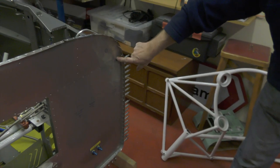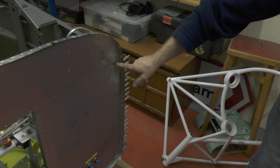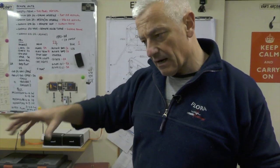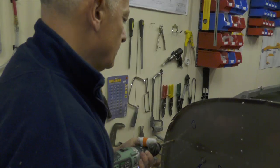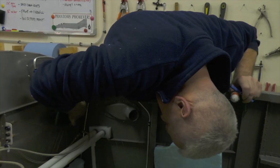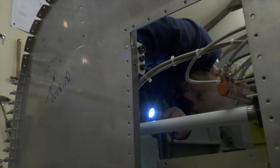The first one's drilled, it's been cleaned out, and the bolt fits very nicely in it. I've hung the engine mount on there, I've lined it with the other two — this second hole is perfect — so I'm just going to drill that in position without the engine mount on. That's better.